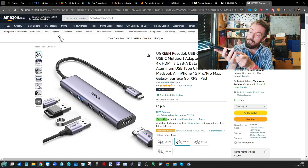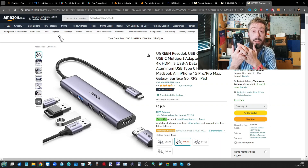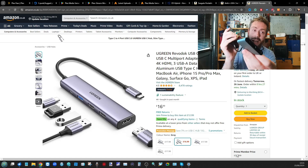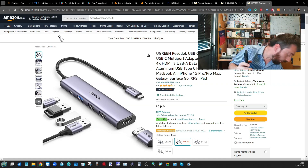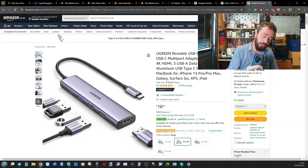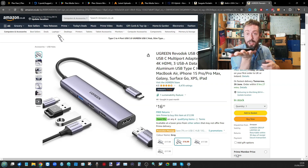The next thing we need is an adapter that connects into the phone and adds our storage. Once we connect a storage drive into our phone, the phone isn't receiving power. So get an adapter that adds both a USB Type-C and Type-A port — that way you can attach the storage drive and also plug in a power cable simultaneously, so the phone charges while running Plex Media Server with the connected drive.